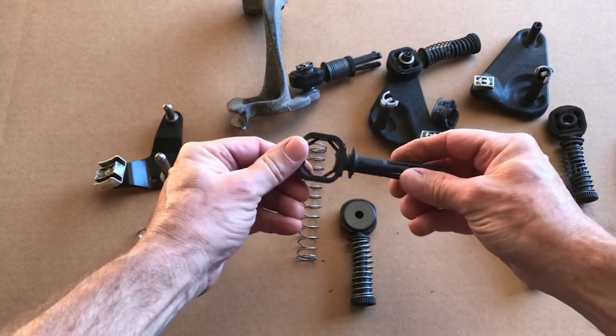If you have a stock-type shifter, this goes on just fine. If you have the Sigma shifter, it goes on the same sort of pin just fine and you're ready for installing into the car. Now that we've got our perfect pivot inserts in our side-to-side cable end and the bell crank assembled in the correct orientation, we can go ahead and start working on the installation of the shifter.